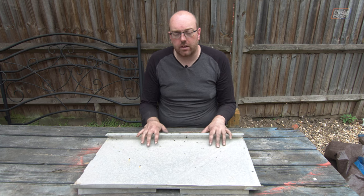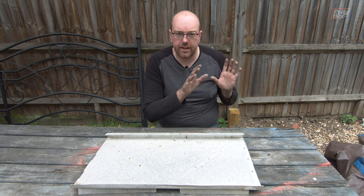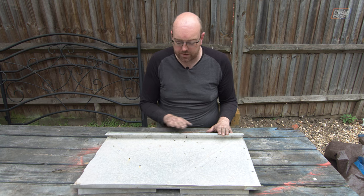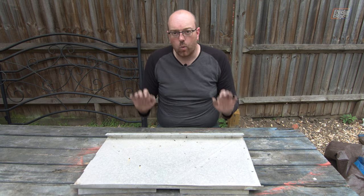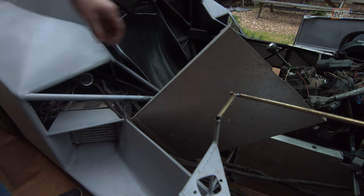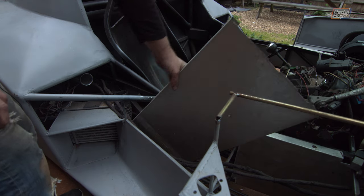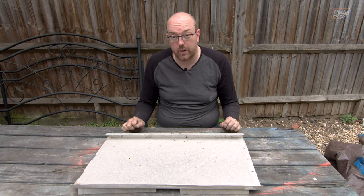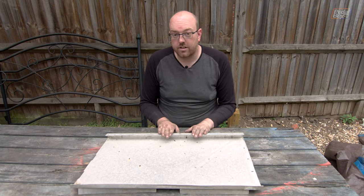Now the front half of this panel has been cut off and is fitted onto the chassis. We need to deal with the back half, and this is a difficult one because this panel as it is will not fit through the gap in the chassis, and even if it did fit through the gap at the top, if we ever needed to remove it we wouldn't be able to — we'd have to take it out through the floor once all the rest of the panels are welded on.